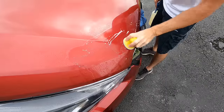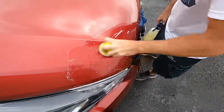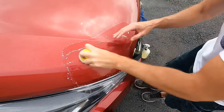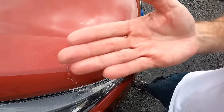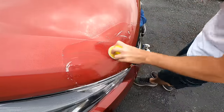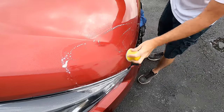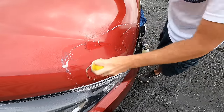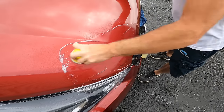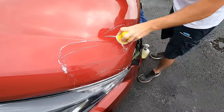So we're going to keep sanding until you see this white frothy film or sediment that will start to accumulate and run off the hood. And that's what this stuff here is, and that is the dead paint molecules or the clear coat. And since I can see through and oxidation is rough, I'm going to sand until I can see it smooth, and then I know the oxidation has been shaved off or exfoliated, or the best word to describe the process.